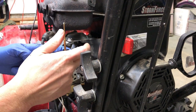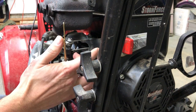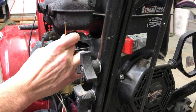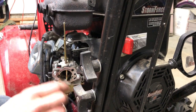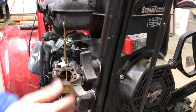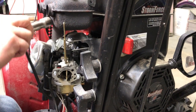We'll undo this lever — it comes off the gear inside the crankcase that regulates the speed, basically tries to keep a constant speed and opens and closes the butterfly valve based on that. Pretty straightforward — we'll probably just take it off and give it a cleaning, that's really all it should need. Maybe we'll also check the spark plug on here.